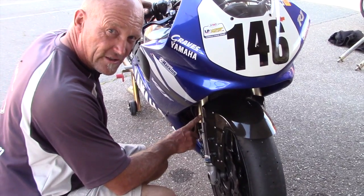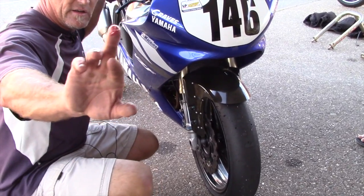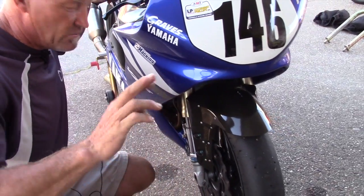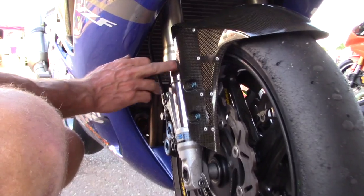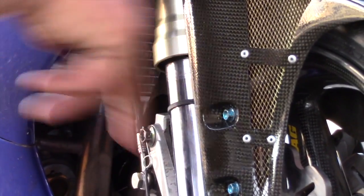Inside the oil seals, there's a grease groove where you should keep grease, and we've done a video on that with Yamaha and Chris Lessing. You can look for those videos from way back in the day. You need a tiny, tiny bit of grease. You don't need much, because grease aggregates dirt, and you're going to smear it all the way around the fork, getting in and around, and then do the other leg in exactly the same way.